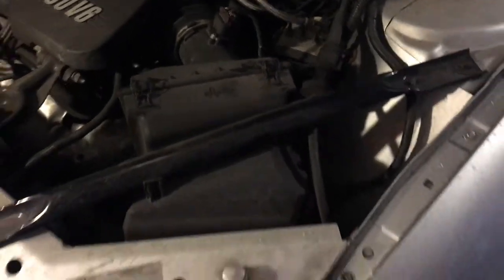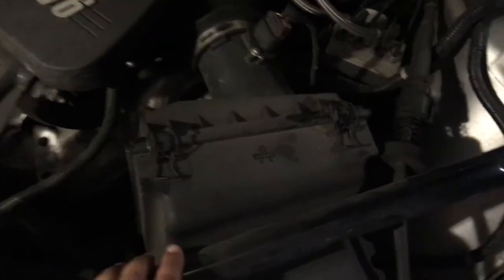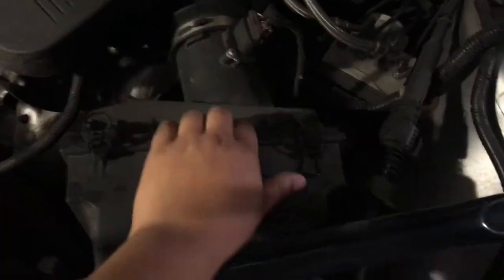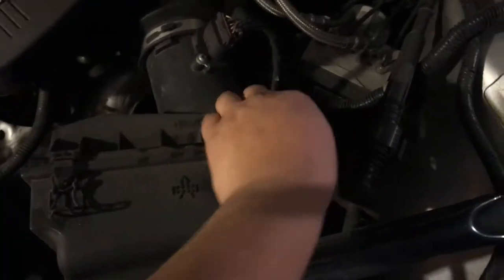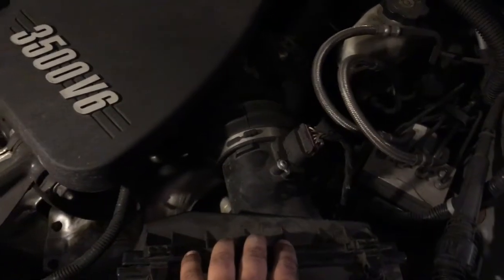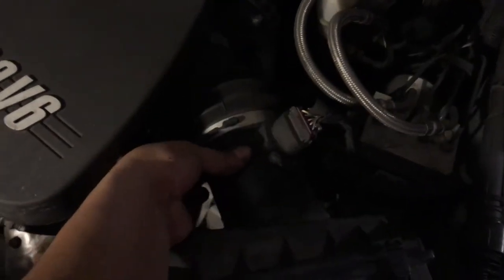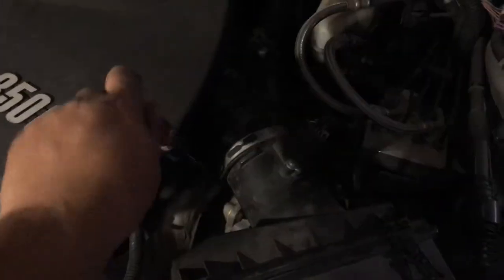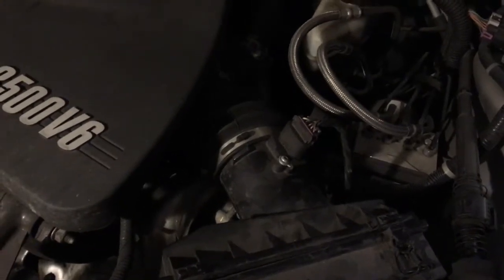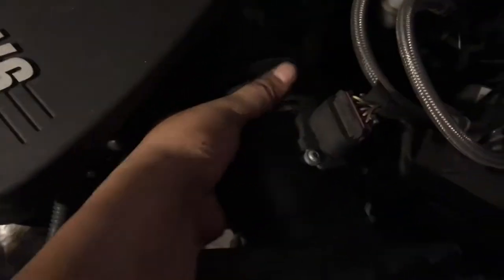Welcome back — today we're going to be doing some simple work on this 2011 Chevy Impala. Right now we're going to change the air filter. To do that, all you've got to do is remove these two clips, flip them back over, and there you go. Next, you're going to have to take part of this housing out, starting by removing this clip or at least loosening it so you're able to slide it over. You're going to need a flathead screwdriver.